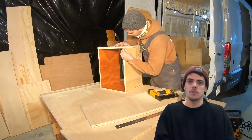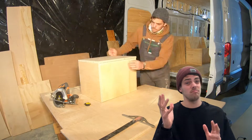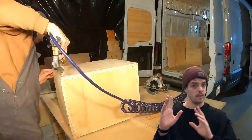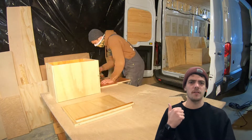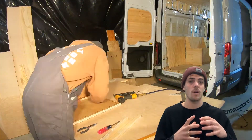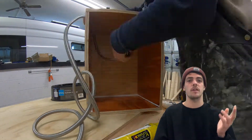Now the second half of this video: propane — or LP gas hookup. I learned a lot about RV LP installation in this process. Our setup is on the simpler end; at this time we only have our propane running to our gas stove — no heater, no oven, no water heater. I am not a professional, so continue at your own risk. Unless you want to use small LP tanks or have the tank mounted outside your RV — which turns stealth camping into obvious camping — people generally go with a vented locker.